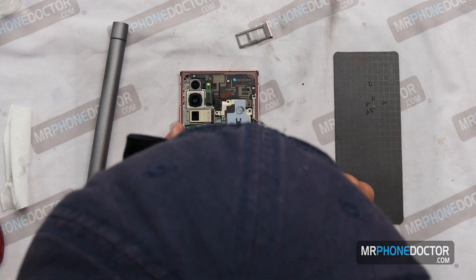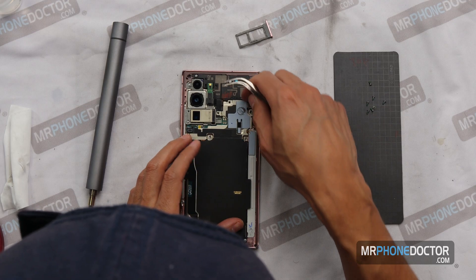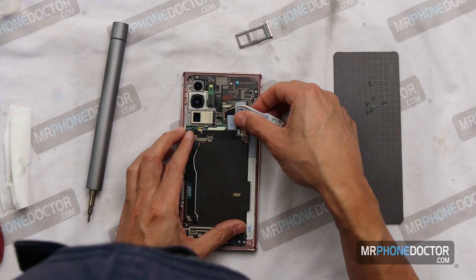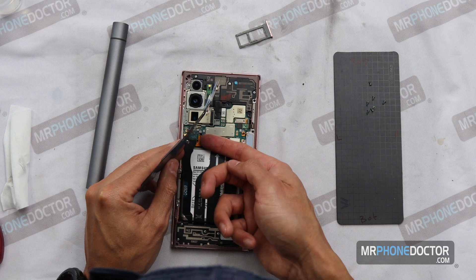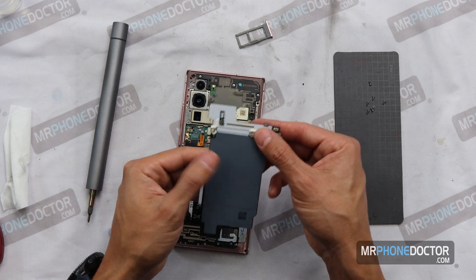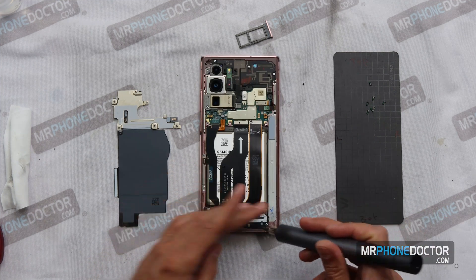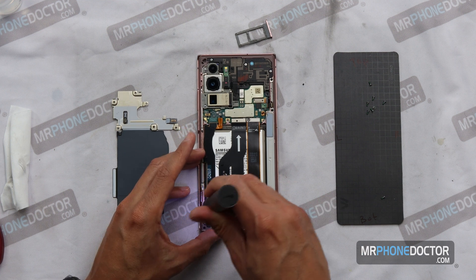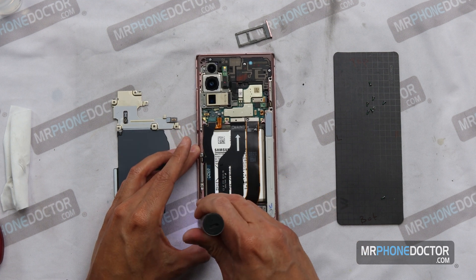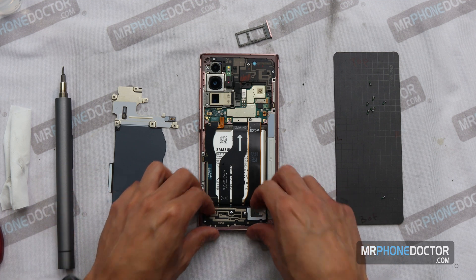Okay, so that is off. Let's go ahead and just lift this up gently. Looks like this is connected — normally I like to kill the battery first, but in this case the only way to access the battery is to remove this first. And the battery is right here. So here's your QI charger back plate and your battery, which has been removed. Let's go ahead and loosen all these lower screws covering the charging port and the flex assemblies. You guys can use this teardown video for the charging port, the cameras, and the battery — just follow this guide.